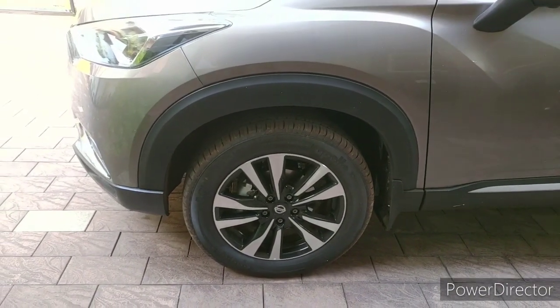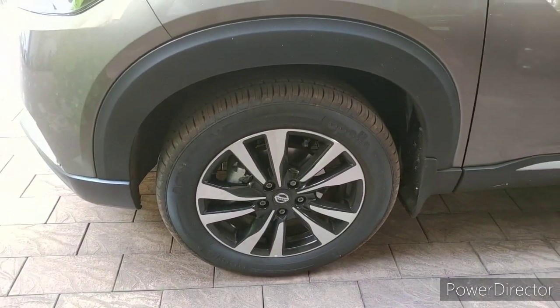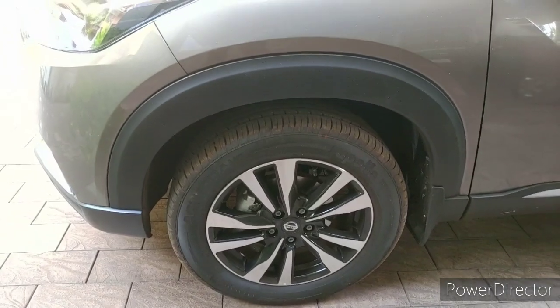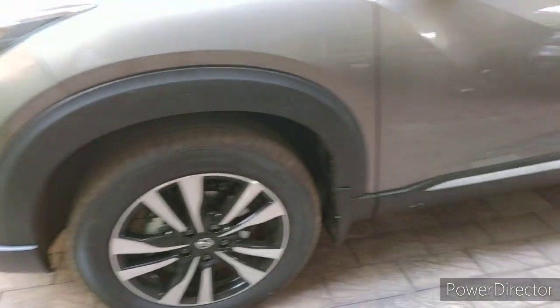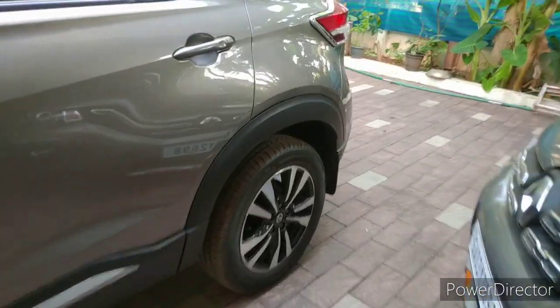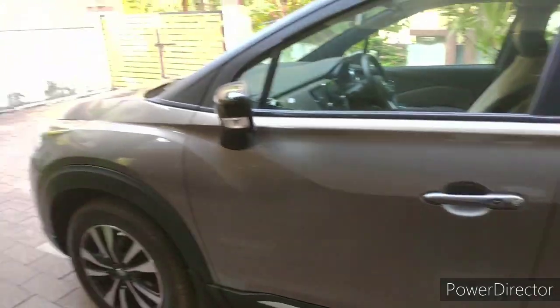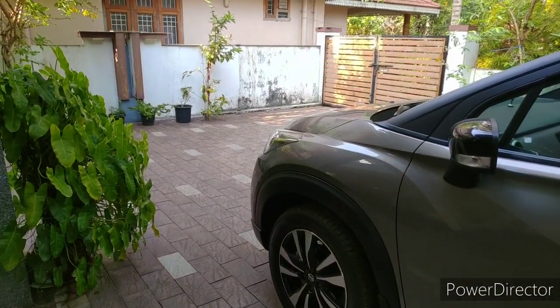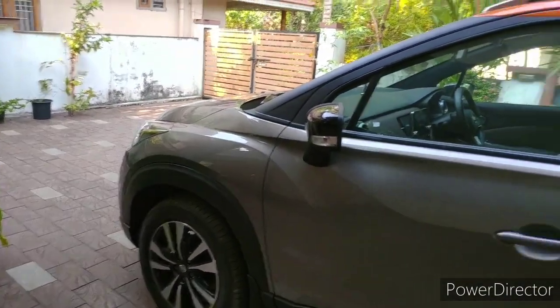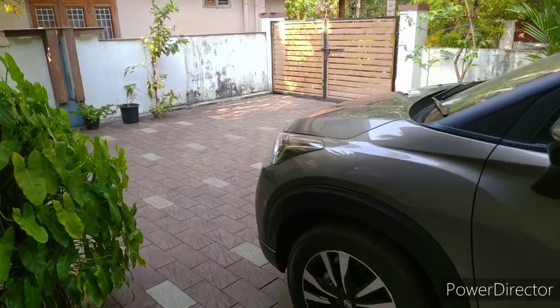Otherwise there are chances that your tire may get a flat spot because it's parked in one position and it's not moved. This will affect the life of the tire and can also result in early cracks in the tires. So there is no need to go for a long distance drive or short distance drive. You can just move the vehicle further backwards. Just a small distance, a small up and down of the vehicle will do.